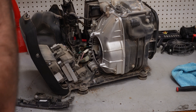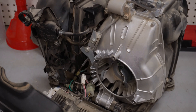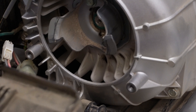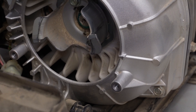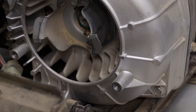We've got the pull starter off. Now we're going to rotate this carefully — we've got a ton of pieces. I'll bring the camera in because this is where it gets a little tricky. Okay, so this little triangle right here is a timing mark, and that is going to help you find top dead center compression — TDC. That's going to allow us to know that both of the valves are closed so we can measure our valve lash and see if it's in spec or not.